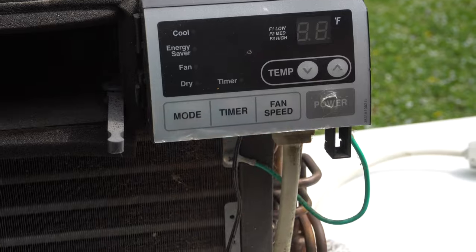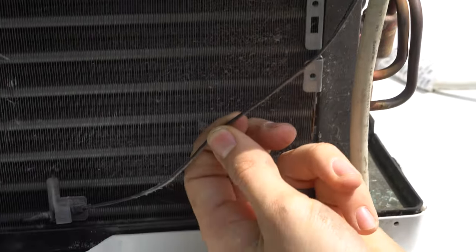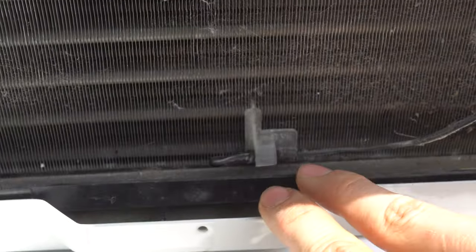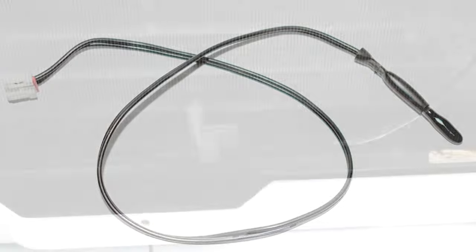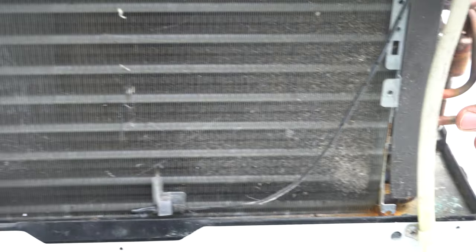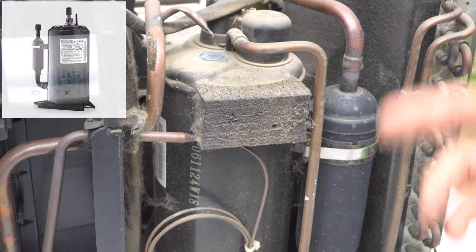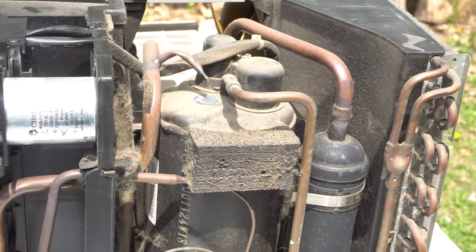Here is our temperature control — you've got the power cord that comes right into it. Out of the temperature control comes a temperature sensing bulb, which usually plugs into the bottom of the evaporator coil right here. What this bulb is responsible for is measuring the temperature coming into the unit, basically the temperature inside your house. All of these refrigerant copper pipes go around here and into the compressor — this black cylinder piece right here. The compressor is responsible for pumping the Freon from the evaporator to the condenser coil, and it just goes in a continuous loop, round and round.